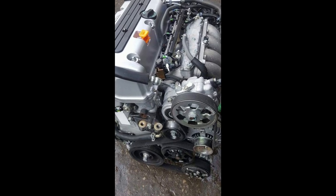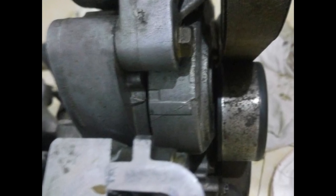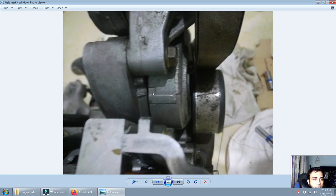If you have changed the steering pump or the idler pulley, check the belt tension marker. The triangle should be exactly between the two squares — that is the perfect belt tension. If the triangle is not between the squares, you either have a too-tight or too-loose belt, or a faulty idler pulley.